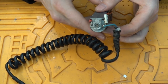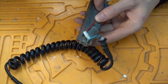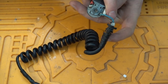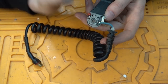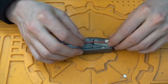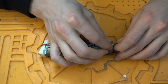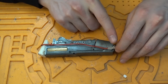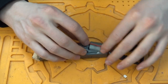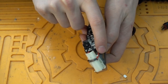The minus cable goes here onto the motor on this side. Black is always minus, red is always plus. In my case I have blue and gray — I designated blue as minus and connected it to the minus of the motor. The plus I connected to the smaller diameter 0.75 square millimeter cable, because the spiral cable is too big to fit into the groove. I put some isolation tape around the connection — a shrink tube would be better, but there's not enough space. The other cable goes all the way up and over the top of the nozzle housing, rather than to the switch unit.